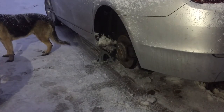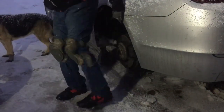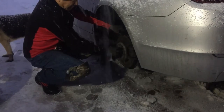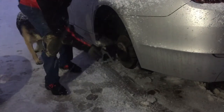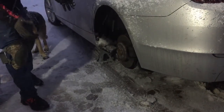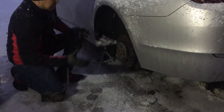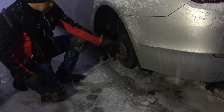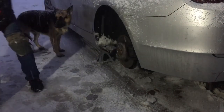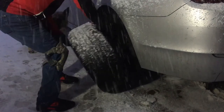Sometimes the rim will be stuck. What I do is turn around like this and kick the tire — that'll break it loose. It gets stuck because of rust. If you have a hammer, hit around the tire and it'll break loose. Now, putting it back on can be tricky, especially on a BMW. American cars have studs that stick out so you can set the tire and hold it there. BMWs don't have studs sticking out, but just bring the tire, align it with the bolt pattern, and that'll help you.